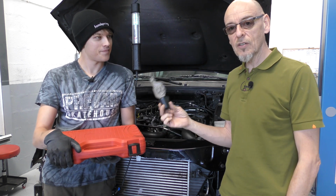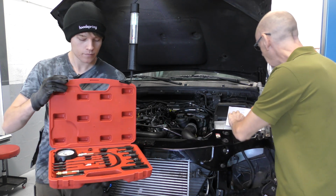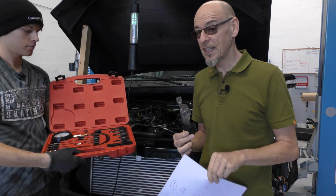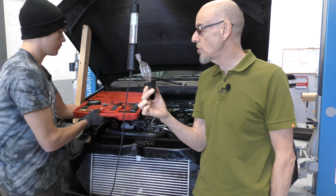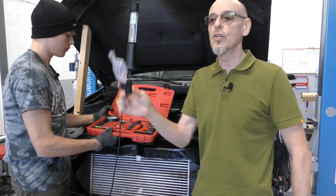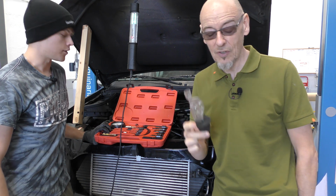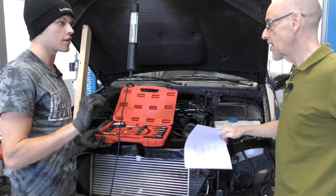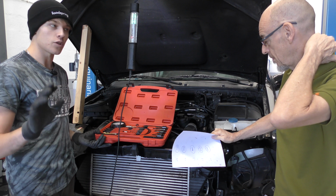Yep. We went ahead and got a compression tester, or borrowed one. To be 100% sure. And as you can see, we have a perfect head and head gasket. So this, and every video I've ever seen on YouTube, they say, if you use this and the colour changes, you've got a head gasket problem. Well, we haven't. We 100% haven't got a head gasket. No. So all that told us was we have exhaust gases going into the coolant, which we'd already gathered, basically. Well, we got bubbles, so we're not really sure we needed that.